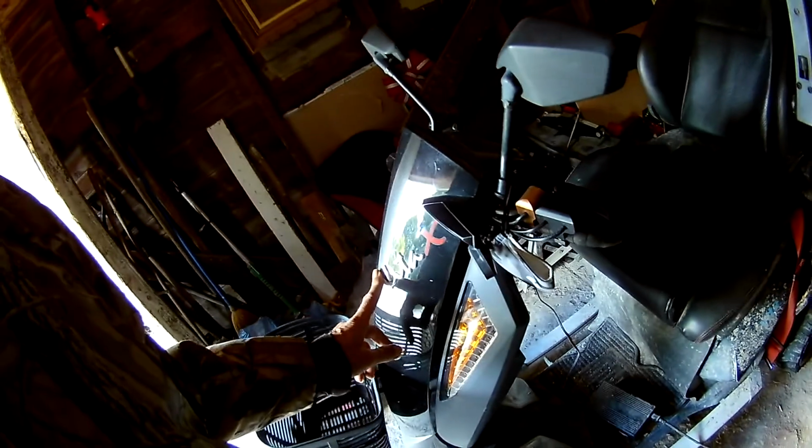I have a feeling it's my relay for the front light. There's a mounting tab on it that just slips onto whatever, and I just wrapped a zip tie around it and pulled it tight against the frame. I have a feeling the tab slipped out of that, because it sounds plastic. If I hit bumps, I can hear it rattling. It's annoying, the more annoying part being not knowing what it is, but I'm pretty sure that's what it is. So, if that's it, that'll be an easy fix.